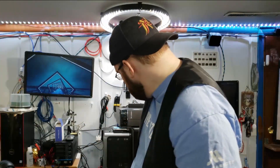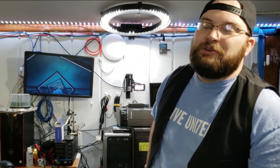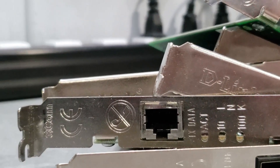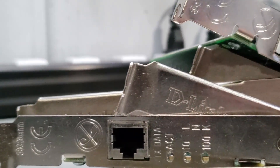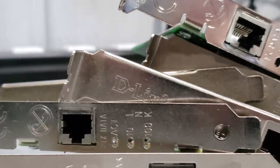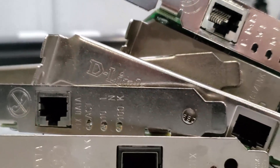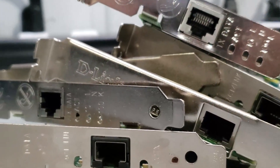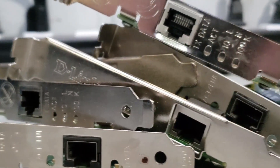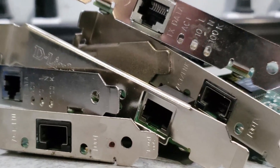The final thing on this checklist is going to be a network card for your PFSense server. This is a super basic network card, and it actually works with the computer we're planning to use for PFSense. PFSense is going to be the lowest of our three systems — it doesn't need as much resources — so we're fine going with an older system and old school PCI cards. This one is only 100 meg. We have used gig cards in my personal PFSense server, but for this one we're just going to use 100 meg so anyone can do it.